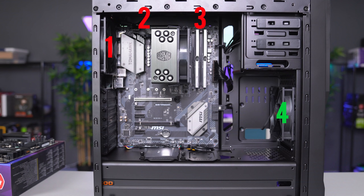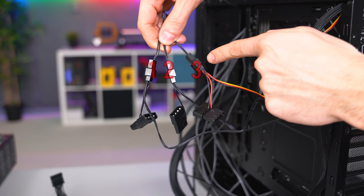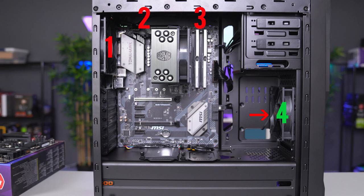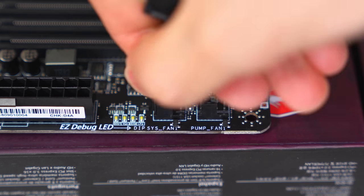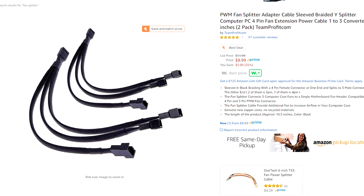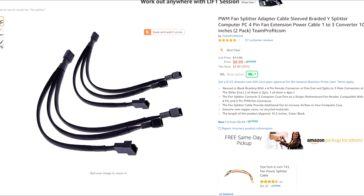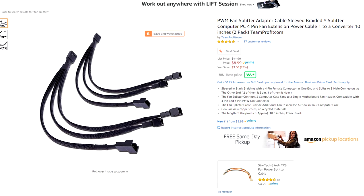Now since I have a total of 4 fans and 3 of them are connected to the fan controller, I still have 1 left to connect. So I plug the fan which is in the front of the case to the fan header on the board labeled system fan. If your motherboard does not have enough fan headers for all your fans, you can pick up fan splitters which are sold on Amazon, and I'll drop a link below if you want to check it out.